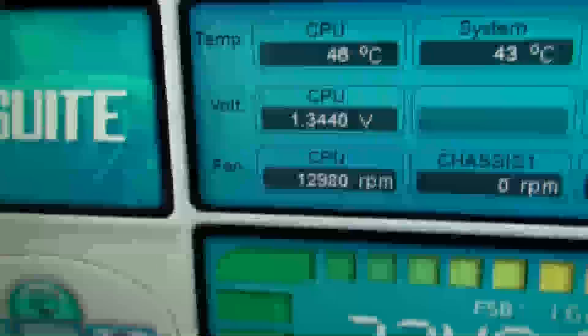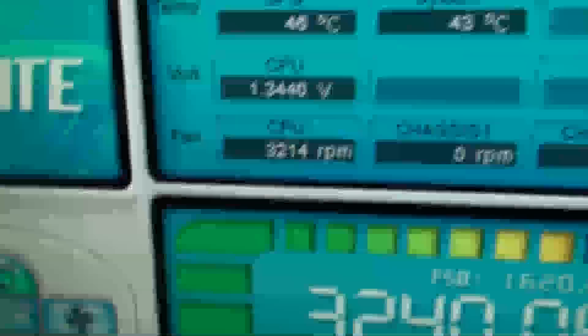I'm sorry for going handheld on this, but it's the only way. Now I'm on my desktop, and this program called AI Suite is going to help me read the fan speed — you can see the CPU fan is currently at 0 RPM. So if we come down here and turn this on, get that spinning up, and then come back up here, you can see once that stabilizes it should drop down to about 3000 RPM. There you go. And you can see that even though we are not running off of the motherboard, we can still control the actual speed. If I turn this knob down here and come back up and check, it's actually dropped down to 2000 RPM. So how freaking cool is that?